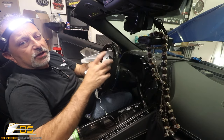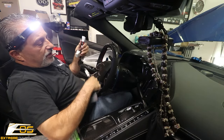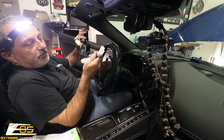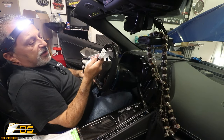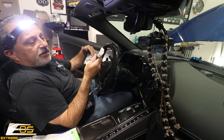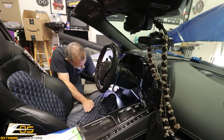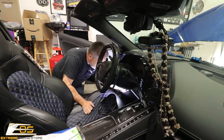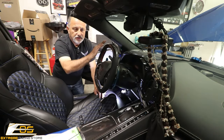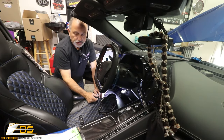You can do something in line — I've seen people do that where they've got other things like window valets and can still plug this in. But like I said, if you're doing scan work, just unplug this and let the scanner plug in direct. What I'm going to do is pull the side trim panel up and take this back behind there — it's out of sight, out of mind. I'm going to go ahead and plug this into the OBD2 port, and then go ahead and hook up the battery.